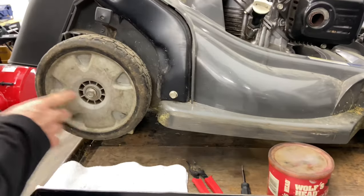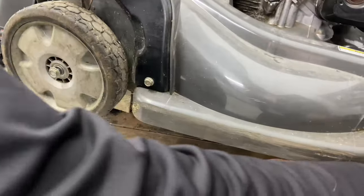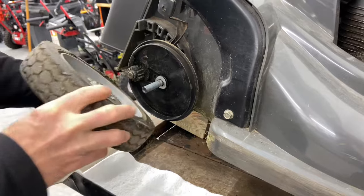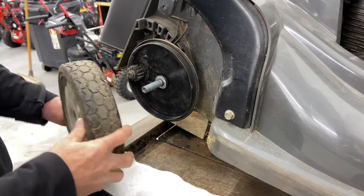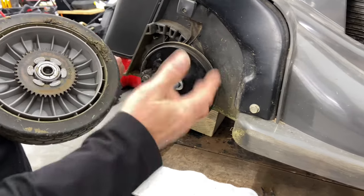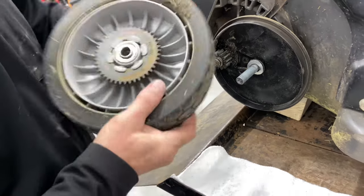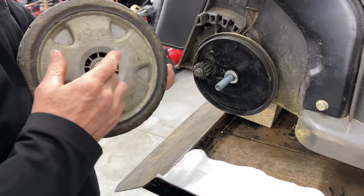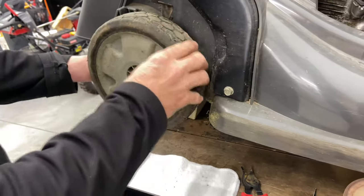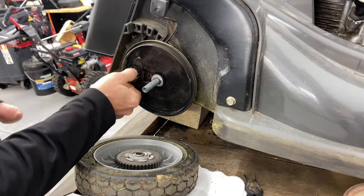So we have it up on a bench. It's a 14mm socket — I'm going to take off just the bolt right there. You want to check your bearings on your wheels while you're here. Sometimes I've had a hard time getting the wheels off the shaft, so it may be a good idea to put a little lubrication on these if you're in very moist conditions. Just spin your bearings on your wheels. These are getting a little bit noisy, but the clicking is right here.